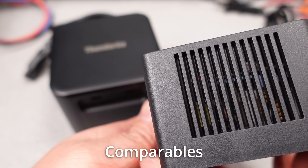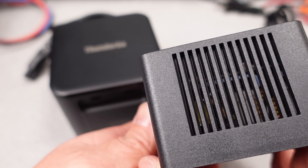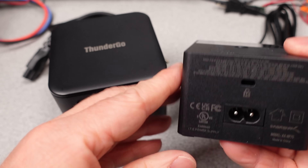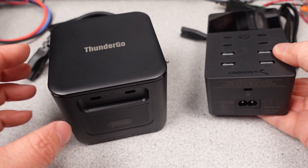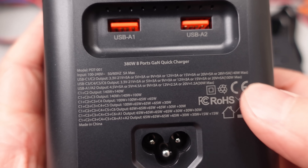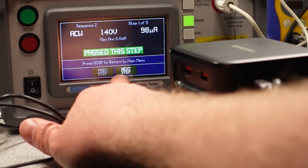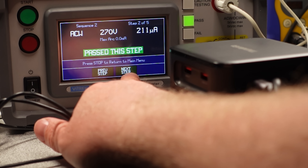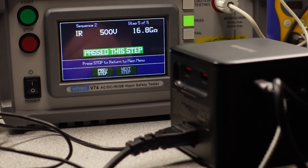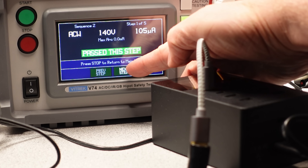Time to compare these chargers. These are big ones, so I'm going to compare to what I've tested for larger chargers — the Anker 240W, the Ugreen 300W, and a few others. The ThunderGo is the biggest charger I've ever tested, and it was a challenge for sure. In terms of isolation — the thing separating the dangerous mains side from you on the low voltage side — these both do okay. The ThunderGo does have a direct earth connection to the USB ground pins on the ports, so keep that in mind. The leakage will be shunted through this path. Nothing really sets off any alarm bells here.